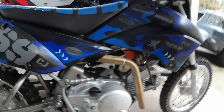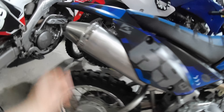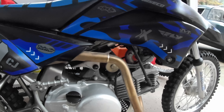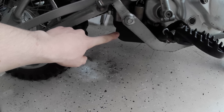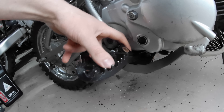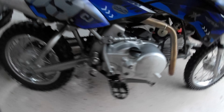For mods, like performance, the only one we got is this knockoff T4 Piranha exhaust. It was like a hundred bucks on Amazon. It runs great. We got it jetted with a 95 main jet and then stock pilot. Down here, a little lower, we have a BBR frame brace and then a Twin Bros heavy duty foot peg cradle.